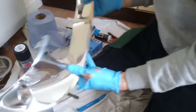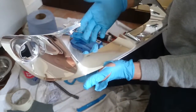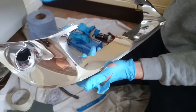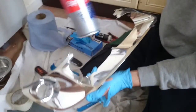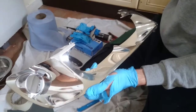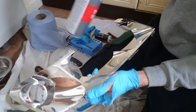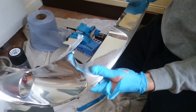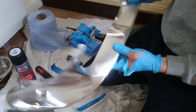If you're going to do it professionally - the ones I've got in the car at the moment are Cossack grey - I primed it, flatted it, then primed it and flatted it again, then did like two coats of top coat and lacquer. I'm just going to use some matte black - some satin black - because it's a quick job, not too much weight, not too much paint. You're going to need decent paint if you're going to run high temperature HIDs that are going to cook it.